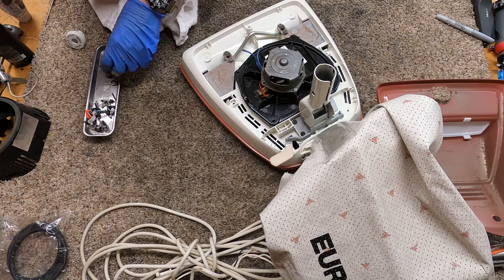We are almost done. The next step is to put the handle on — this had that plastic handle, and I washed the whole thing. When putting those back together you need either a lot of Loctite or some super glue — dealer's choice. These screws, same as with Royal Uprights, didn't come with Loctite from the factory and they just wiggle loose. So this just goes in like so, and then you want to crimp it down until the play is gone on the handle. Don't over-tighten on these plastic handles because they are brittle and can break.